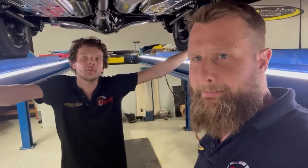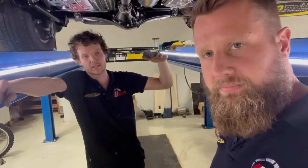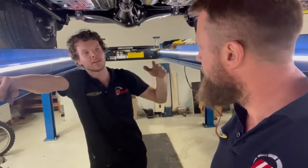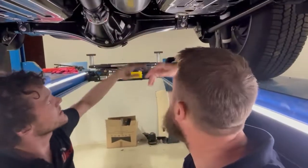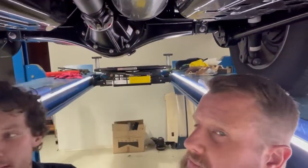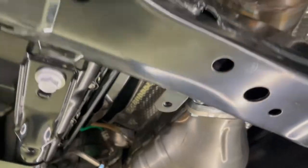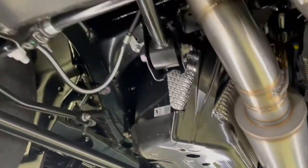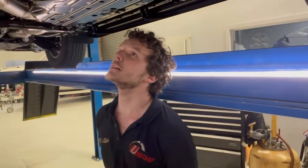From start to finish, we pulled the old exhaust off and we pulled the old springs out, which allowed the car to be at full droop so when you're going over rocks, the exhaust isn't going to fail on the suspension. We pulled the springs out, exhaust down, so we got full clearance up there. We started at the front — we got a laser cut flange custom made that bolted straight up to the factory Toyota DPF system. We made the front section without a flex first, which kept our rear nice and square so it doesn't hit anything, then we added in our flex, checked it again that it didn't swing or sway or hit anything, and then jigged it up to arrive at the product we can sell to you.